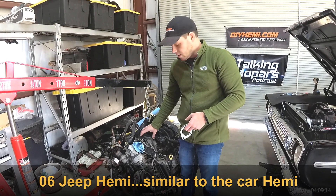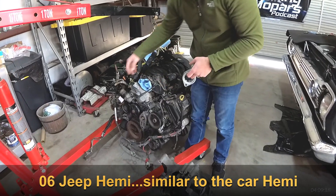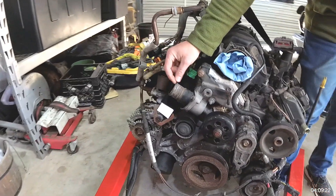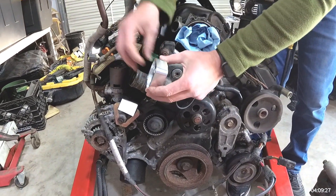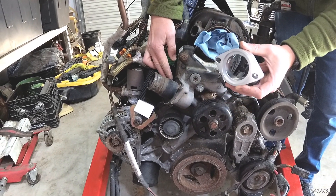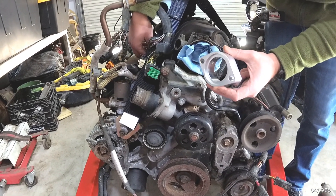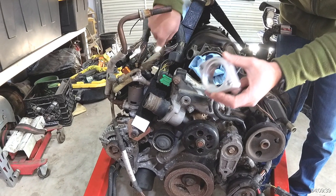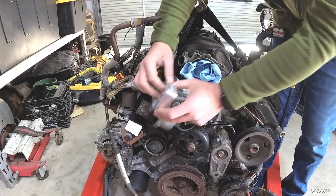It really is just like the car engine with the exception of the oil pan. It uses the same intake manifold, the same timing arrangement, the same accessory drives. You'll notice that the thermostat and the water neck is on the passenger side on this engine. Here, the spacer goes in just like this, placing your two sensor ports right here hidden on the back where the wires can be hidden in the fuel injection loom — the wire loom that houses the wires for the coil packs and the fuel injectors. So it's a really nice, neat, hidden application for your wires.